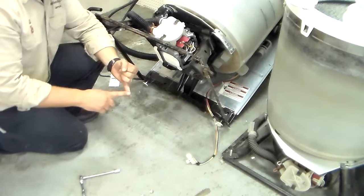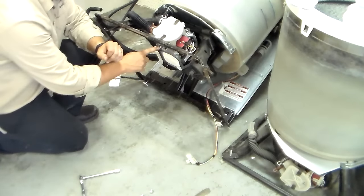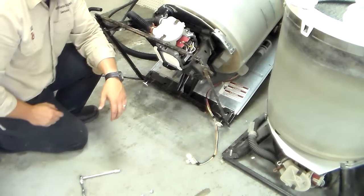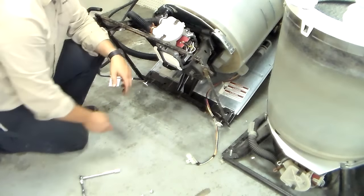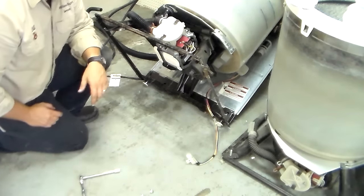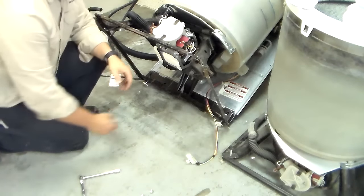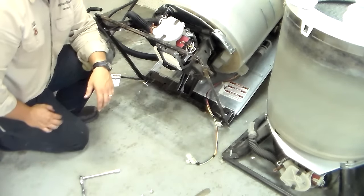And if you had a bad clutch and you just replaced your clutch, it's going to spin. If you had a bad motor coupler, the only thing you were going to do differently was pop off the clips that hold the motor onto the transmission — they're the same clips that hold the pump on. Once you drop this down, you'll be able to work on it because it's going to be out in the open. There's no sense trying to pull this motor off with the cabinet on if you've never done it before — you're going to have a hell of a time. It's a lot easier to just take the bolt out of the agitator, take the pump off, unplug your wires, and slide everything down where you have nice and easy access to it. I've done this a thousand times — I could do this blindfolded. But watching this video trying to figure out how to do it yourself, you don't have that experience, so it's a lot easier to pull this down where you can work on it. That's the best way it should be done.